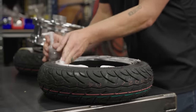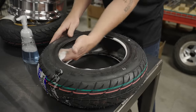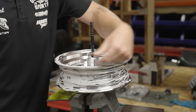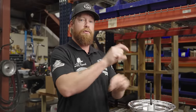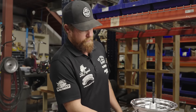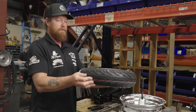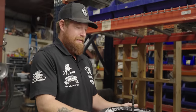These can be kind of tricky to mount. Get lubrication all along the outside, the inside, on the wheel too, and right on the top lip where you'll be pushing it down. The front wheel doesn't really matter which way you put the tire on — you'll just have to move the spacers accordingly because there are two different lengths. I usually do it where the brake boss is going to be on the right side of the bike.